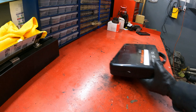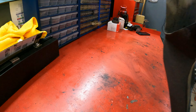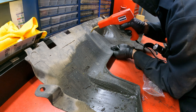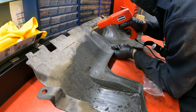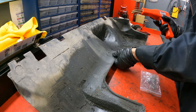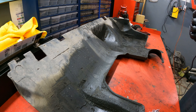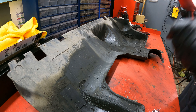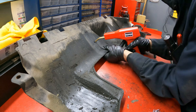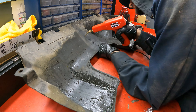I have this tool here — it's called a plastic welding gun. It's mainly used in body shops to fix broken bumpers, but it basically heats up a piece of metal that melts into the plastic and helps bond it together to seal it. I'm not the best at using this tool — it doesn't look the prettiest, but it holds up and it's pretty strong. So enjoy this time lapse of me sniffing toxic melting plastic, but it's all worth it just to fix this car.